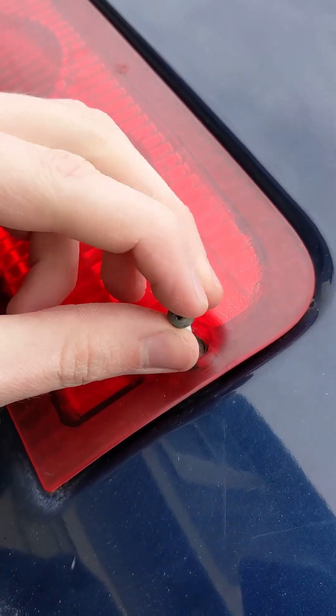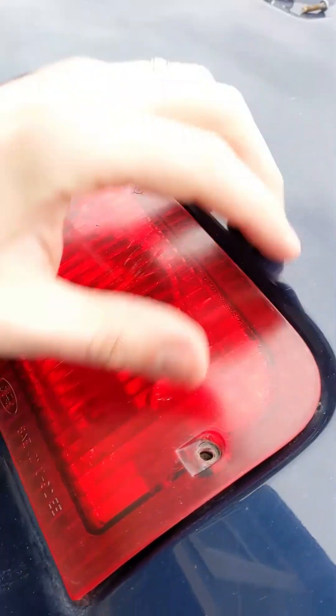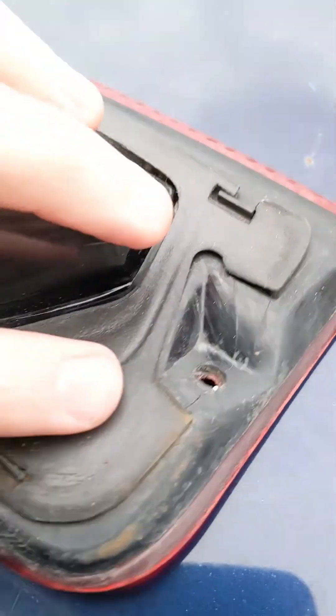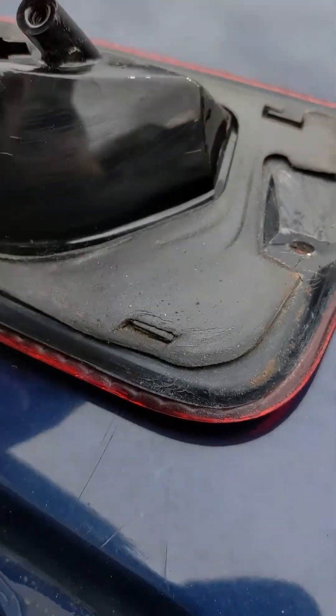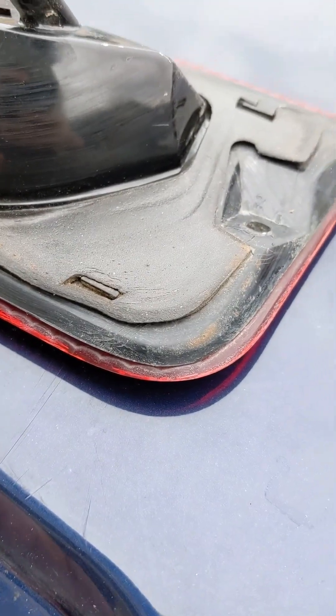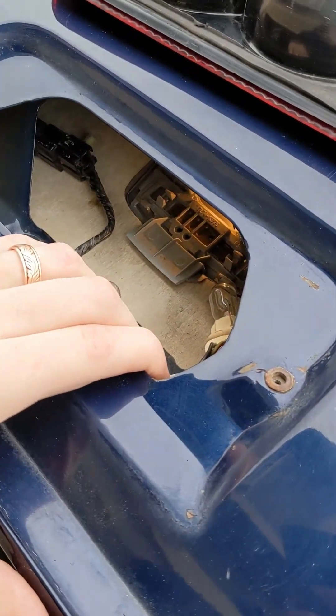To take this out, all you're doing is take out one screw on each side here, and then this guy, with a little bit of force, will pull off because there's a gasket here — it's kind of sticky — that's sealed against this surface. That's usually what your problem is, and you've got water running off of your roof down into your third brake light.